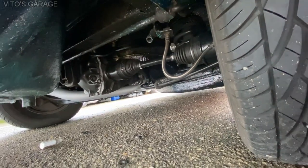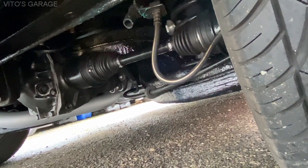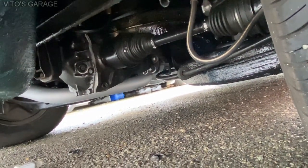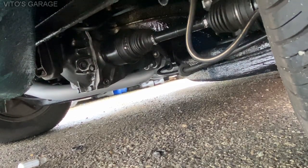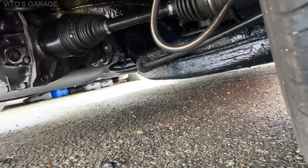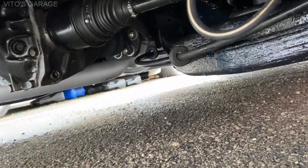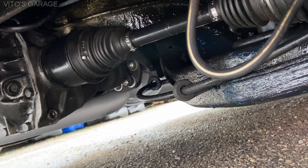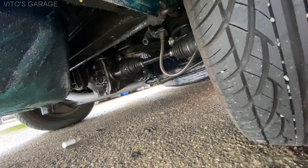Here's the rear end. I refreshed these axles — I put new grease inside and put new CV boots. Also repainted all the axles so they look really nice. The differential side seals were replaced, the rear cover is reinstalled, the differential was resealed and received brand new fresh fluid. The control arms and trailing arms were also protected and preserved using grease. I replaced both driveshaft flex discs as well as the center support and bearing — I used Febi parts made in Germany. Also replaced the sway bar links, rear brake rotors, pads, calipers, and brake hoses.